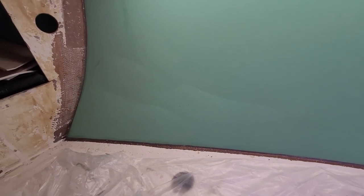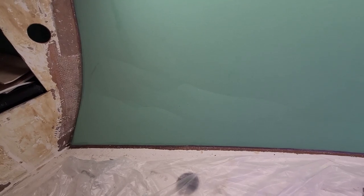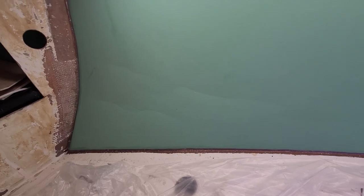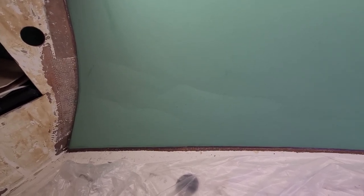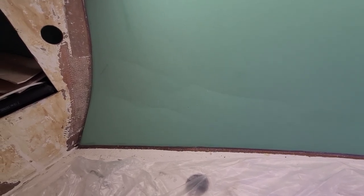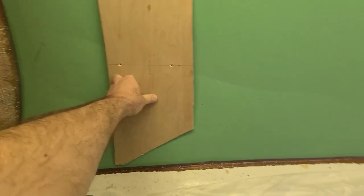I can just cut a couple of holes, fill one hole with the resin and expect the other hole to let the resin go out, and then I just push it back and it will stay, no big deal. Anyway, I see two problems here. First of all, the resin wasn't thick enough, it was more liquid than mayonnaise or peanut butter consistency. The other one is I need a bigger plate for pushing this stuff, bigger than this one, because this definitely didn't work very well.